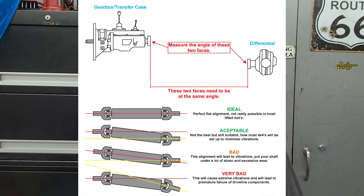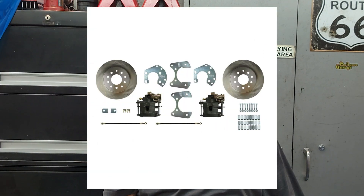Installing a Ford 8.8 in your Bullnose isn't too tricky because it came that way from the factory, but there are a few things to keep in mind. First, make sure your axle has the correct pinion angle for your truck's suspension setup — getting this wrong can lead to vibration issues. If you're moving from a 7.5 to the 8.8, you may need to make modifications to fit the larger axle tubes and ring gear. The axle shafts are thicker, so double-check your clearance. If you're swapping from drum to disc brakes, that'll require new brake lines and compatible calipers.